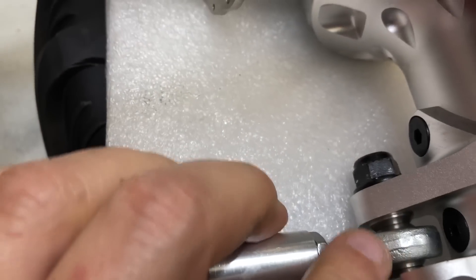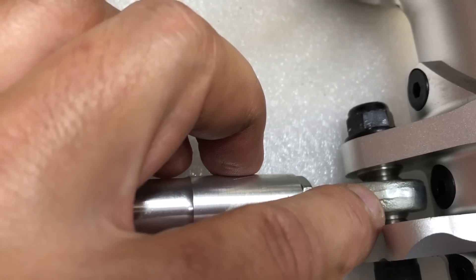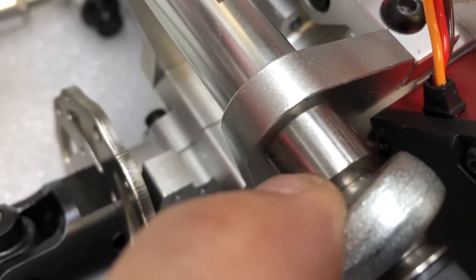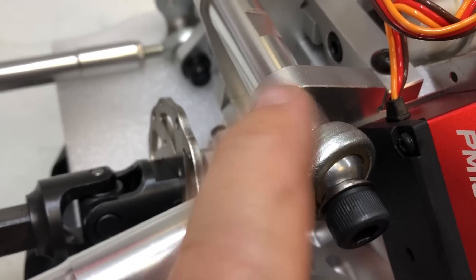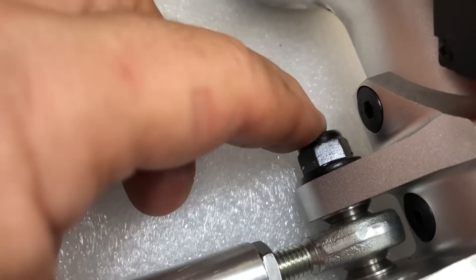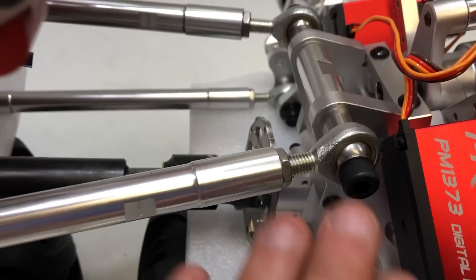With the four links in between the bolts and the cone washers — these special cone washers — you want to make sure the tapered end, the smaller end, goes on the inside toward the ball link of the suspension arm, so that when the suspension pivots up and down it lets it move freely. There are also tapered ends on the top ones — the pointy side where it tapers in should go toward where the ball link goes. Definitely put some blue loctite on the bolts that screw into the aluminum piece, as they could come loose over time. The lower ones have a nylon lock nut insert so those won't come loose on their own.